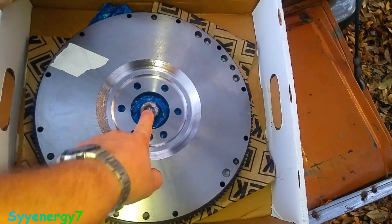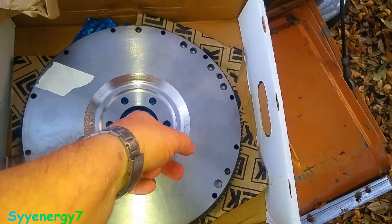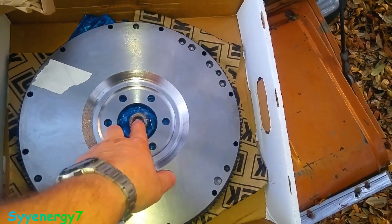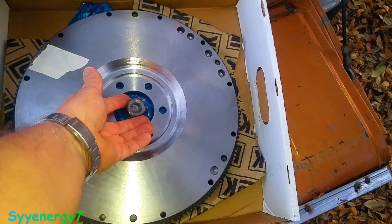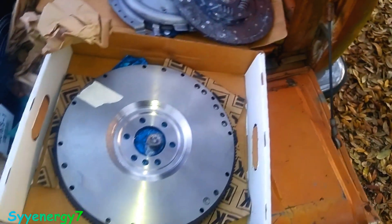The way to get this out is you take a bunch of grease, you fill it up with grease — this would be fit and flush against the crankshaft — and you pack it with grease and get a socket that fits in there real tight with an extension. As you hammer it, the grease gets behind the pilot bearing and starts knocking it out. That's how you get that out of there.